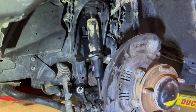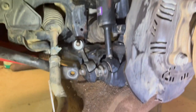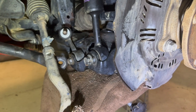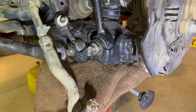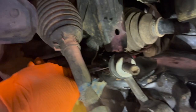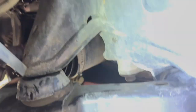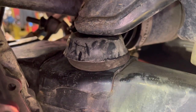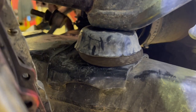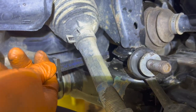What we've done now is remove the coil spring from the shock assembly. We have the sway bar still disconnected just to get everything out of our way, and we've collapsed the suspension as much as we can with the transmission jack. If you look very closely, I'll demonstrate — you can see the pocket scale will fit between the bump stop and the A-arm. That is due to the Timbren bump stop on this side being compressed as much as we can.